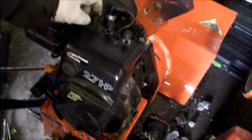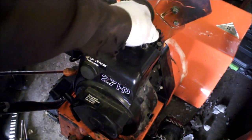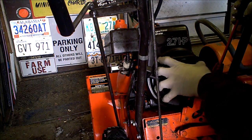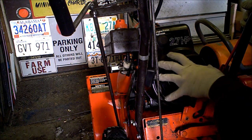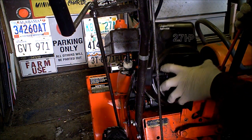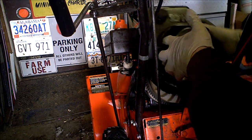What you're going to want to do is pull out three head bolts — the ones in the shroud right in the cover — and then there's one bolt down on each side. The cover should just pull back with a little persuasion. Should be able to get it off.